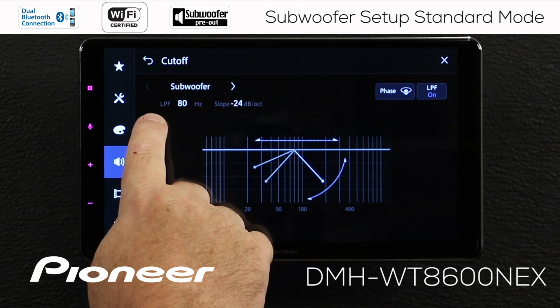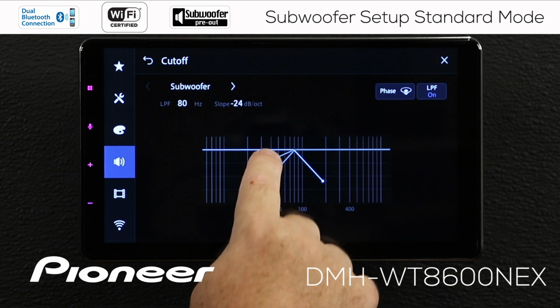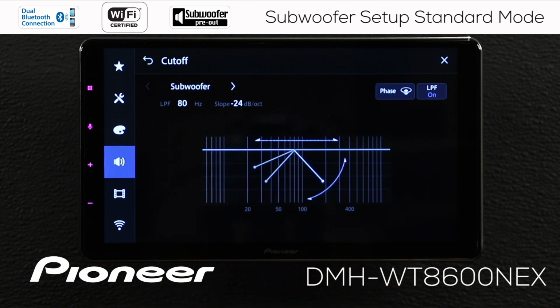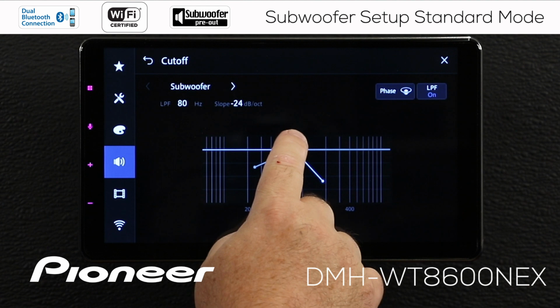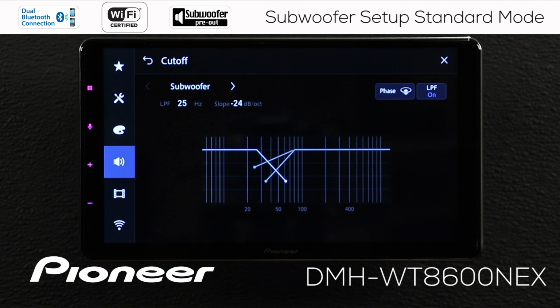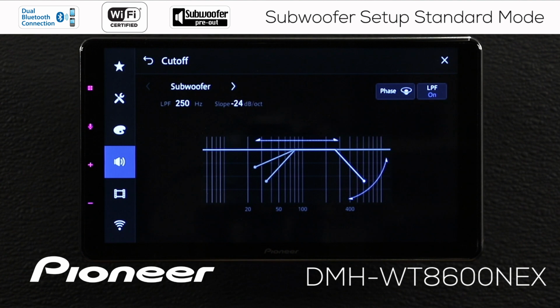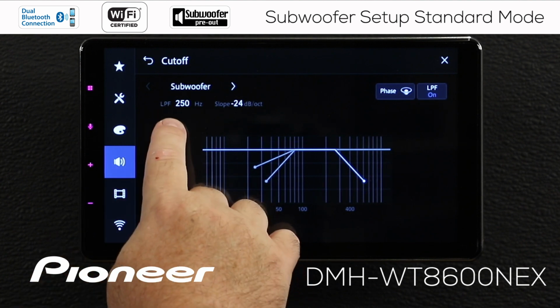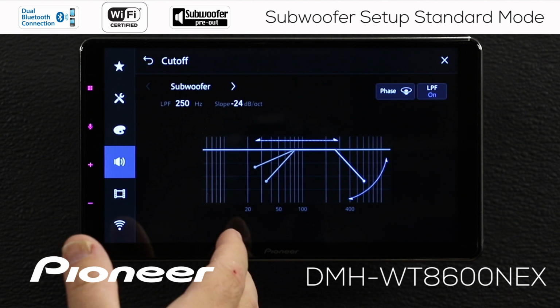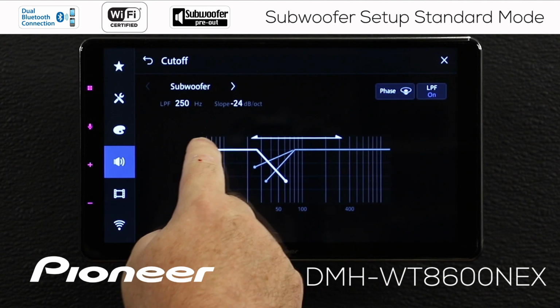The first thing we'll go with here is the low pass filter, or the crossover for the subwoofer. Right now you can see it's set to 80 Hertz, and on this graph we can adjust the crossover point for the subwoofer output. So we can drag this back here, and we can set that crossover point, the low pass filter, all the way down to 25 Hertz, which is very low. And we can move it all the way up to 250 Hertz, which is very high. So what you're deciding here is what frequencies are going to be played back by your subwoofer. In most cases, you want your subwoofer to only play back lower frequencies. So we can choose from a lot of different low frequencies.